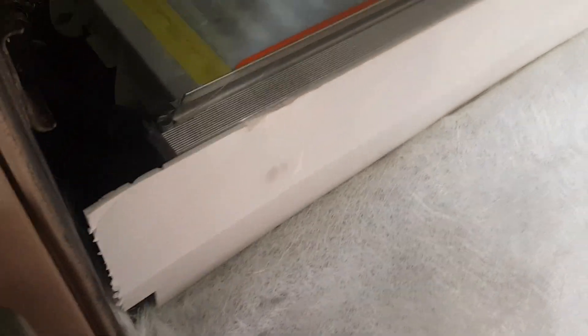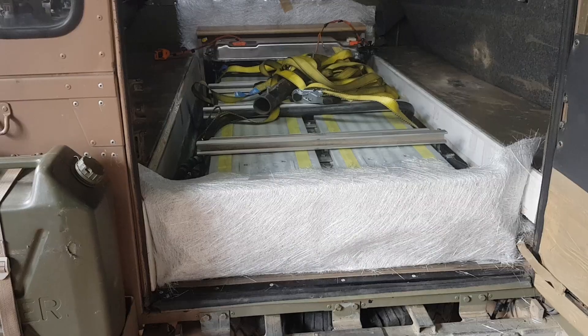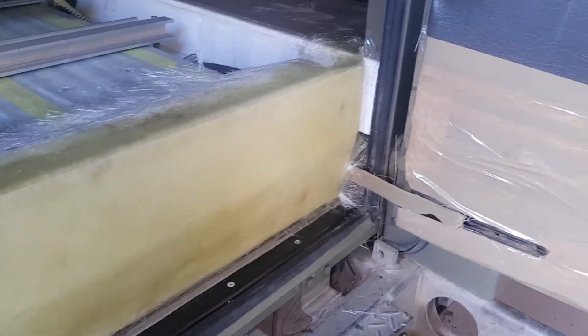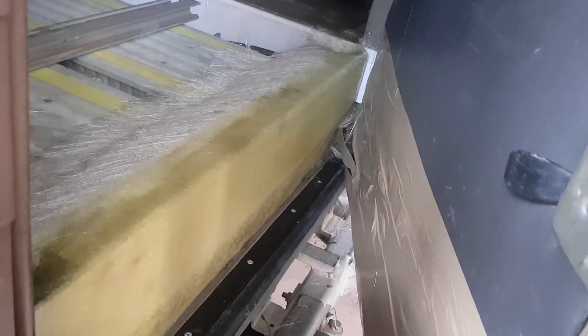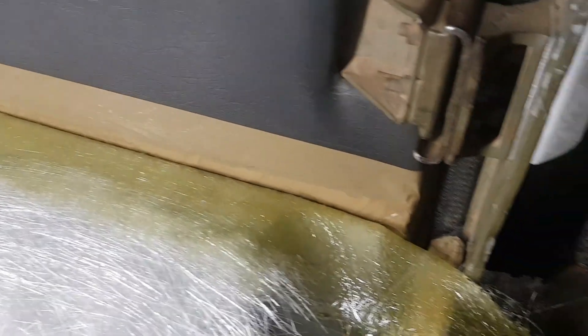On to steps two through six. I assembled it back into the Land Rover together with the battery so I could use the actual battery as the mould. I used some foam as a spacer, then folded up the fiberglass matting before wetting it out and using the rear door to create the mould - the sandwich for the fiberglass. Then I just had to wait for it to harden.